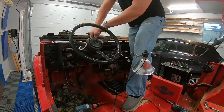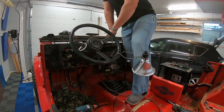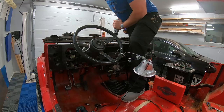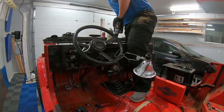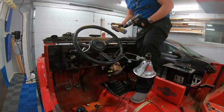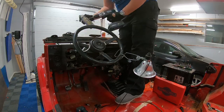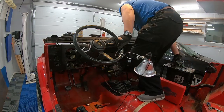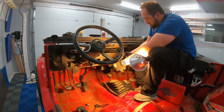It was really quite a nightmare. I thought leaning on it would help — it didn't make a difference, still wouldn't turn. I went through about three different Torx bits just on those screws, and finally just said screw it — I'm going to start drilling them out. I wish I would have started there. In some places you can't drill them out, but this is one of the places where you just drill them out and call yourself lucky, because the whole thing comes out anyway and you can get access. The water seems to gather right in front of the steering wheel — that's where all the Jeeps rust — and ultimately why you had to replace the windshield.